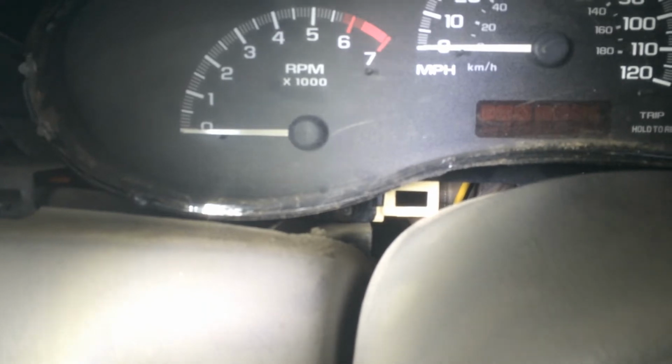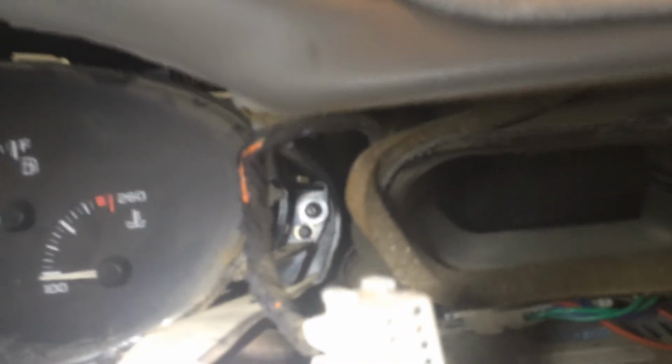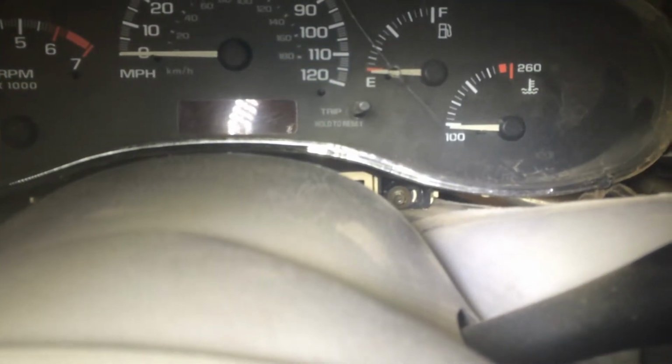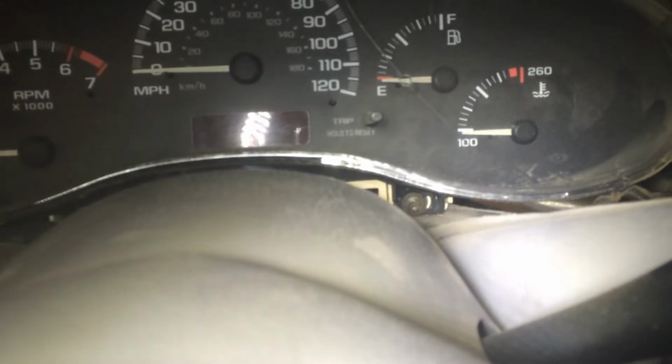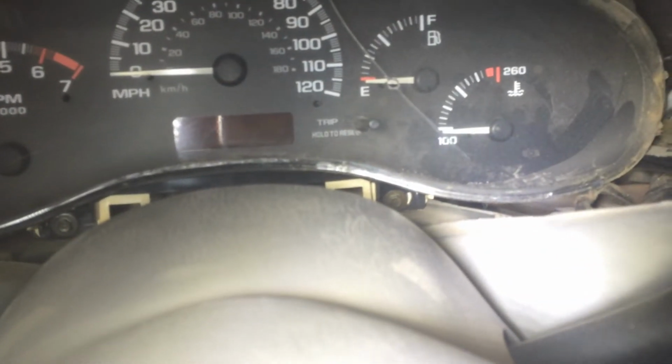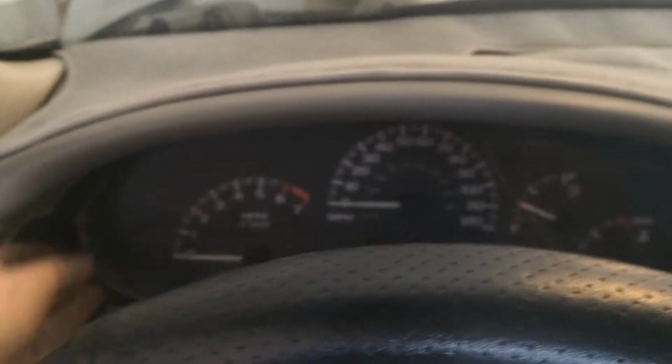And now we have a better view on what exactly we have to remove. Apologize for the bright light, but you have one bolt right down there, one over here that's already missing. It's one less that I have to remove. One right over there. It's that big one on top of that small one. And then one right down there. So let's go ahead and remove all those. You'll have to remember with these two at the bottom, they can be kind of hard to get to, and that's why you have the extensions. You'll want to make sure to take your time, because you don't want to have to fish them out from somewhere if it falls into a hard to reach place. And so with all your bolts removed, just tilt it up and fish it out. And as I said, it just slides right out.